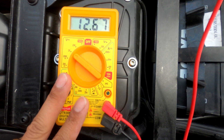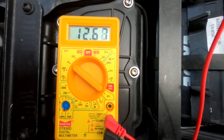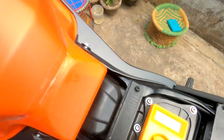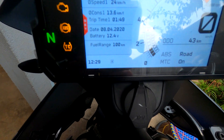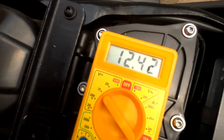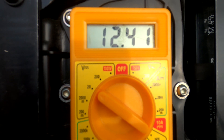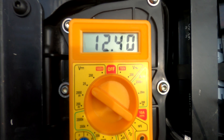I have a basic multimeter here - the voltage reading is showing 12.66. I've connected it to the positive and negative, and when I switch on the bike it's showing 12.4 on both the multimeter and the dash. There's a slight voltage drop when you switch on the bike, but the accuracy is pretty decent.